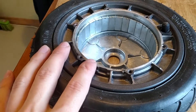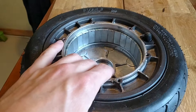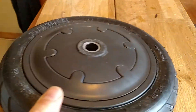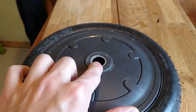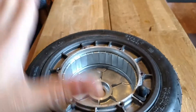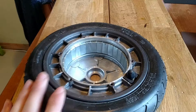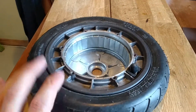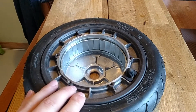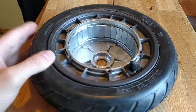By default there was some silicone over the belt area, so it helped protect against water getting inside. However, the bearing on the opposite side — where the deck cover is — that bearing is totally gone, and I started to hear a squeaking noise from the motor wheel while riding, so I knew something was wrong with the bearing.